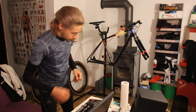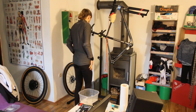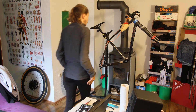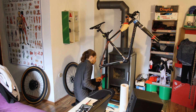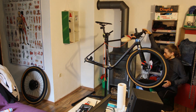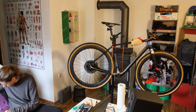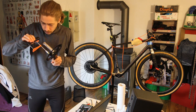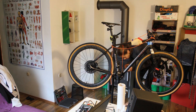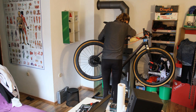The Shimano 105 crankset I used comes from my Canyon Commuter, and I installed a narrow-wide oval chainring by Absolute Black. Though I had never used ovalized chainrings before, I was easily convinced by the concept — smoothing the pedal stroke to increase efficiency and grip and possibly gain comfort. At 38 teeth it is the smallest oval chainring available for this crankset and allows me to ride up even the steepest sections at a reasonable cadence. I live in a very hilly area and don't pedal when already going downhill fast, so the 38/10 high gear — equivalent to a 50/13 — provides plenty of high-end range. The chain line is ideal in this setup, with the chain being most straight in the middle of the cassette.